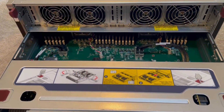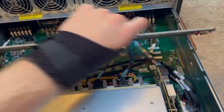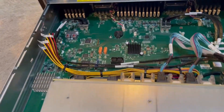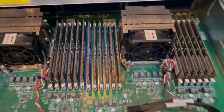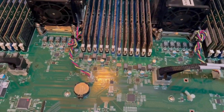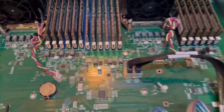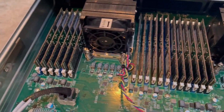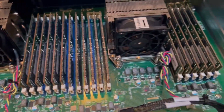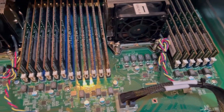This is the lower section — this is all about the processing: CPUs, storage, and RAM. In the back here, they don't have fans blowing onto heat sinks — the fans are actually on the heat sinks, and there's no air baffle either, which I found kind of weird. In here I have 768 gigs of RAM. These are all 32 gig DIMMs. It's still a lot, but relative to today it's not super impressive with the 32 gig DIMMs.